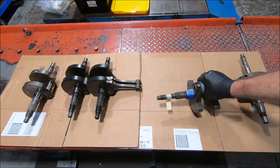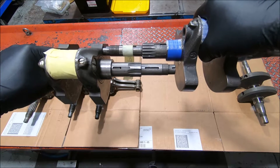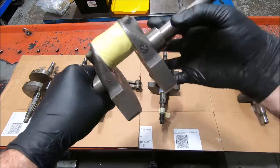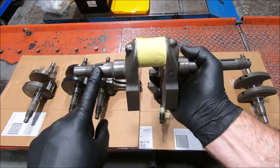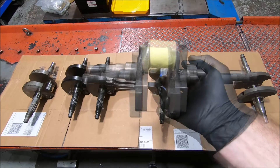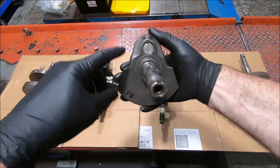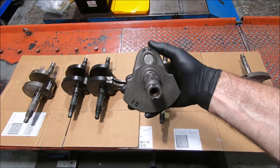This crank is from a 1992-93 onward 900, and you can see it is longer. Main bearing sizes are again the same as the Panta, same as everything else. There's a taper on this end for the primary drive gear, and the big end is 42mm, which it is on all the big block engines - any of the four valves, the 900s, 944s, 1000s. And this one has the much-maligned aluminum plug in the big end - those came out, rubbed against the main bearing, and made a mess.